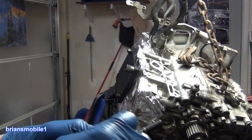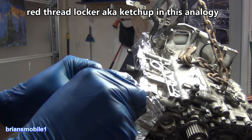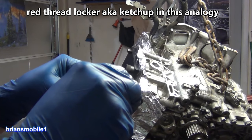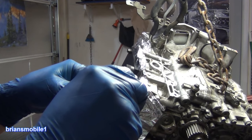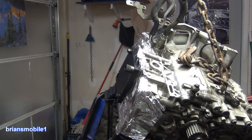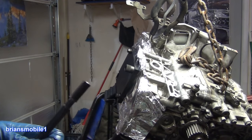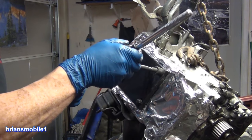We take a red Loctite, and we're going to add that to the mechanical spread that's going to happen. Cheap insurance, right? How do you get rid of red Loctite without ripping threads out? Heat is the answer. So that's probably way too much. You just need a little bit. Knock some of that off. Just a little something to help it to not come out with your head bolts. Let's send it. It also goes through the bushing. Everything goes through the bushing.